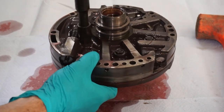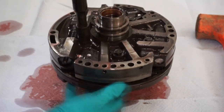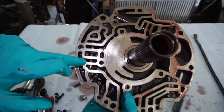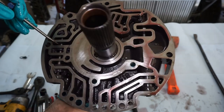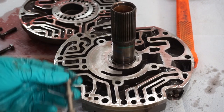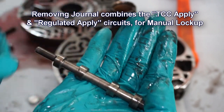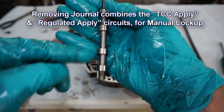Now that I have this separated, I'll take the bolts out and I have better access to this TCC valve to push it out. I got the snap ring off already and I'll just push it out. That plug did come out and I can get the valve out — that's what the TCC valve looks like. I'm going to give this back to him and he's going to take it to a friend to have it machined off instead of just grinding it off. You have a short pin, a long pin, and it's the second one up from the short pin.